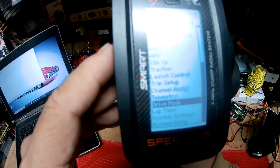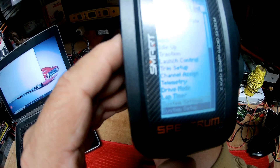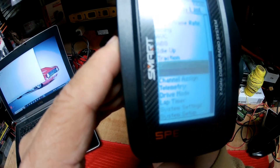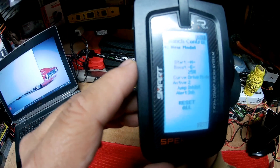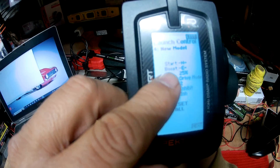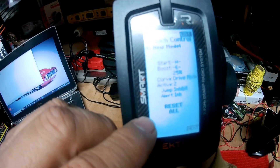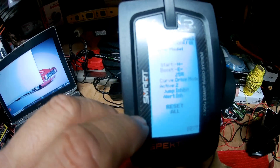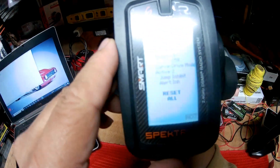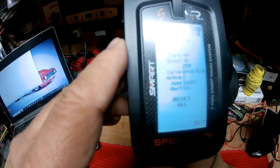From Drive Mode, we're now going to go to Launch Control. Click on it. Here, Start is going to be letter H and Boost is going to be letter E. The amount of boost is going to be 25 percent. Drive Mode — that is something you can change on the switch I'll show you on the screenshot. We're going to be working with Drive Mode number two. Active is number two, Curve is number two, Jump is going to be Inhibit, and Alert is going to be Inhibit.